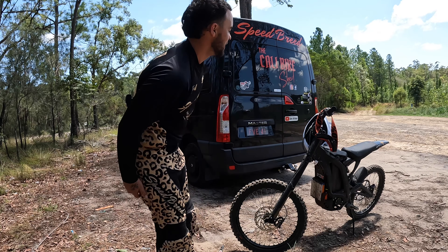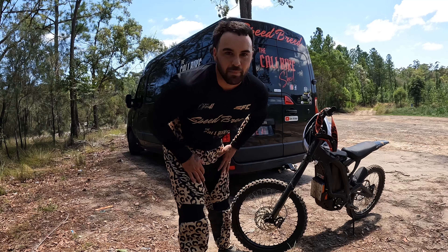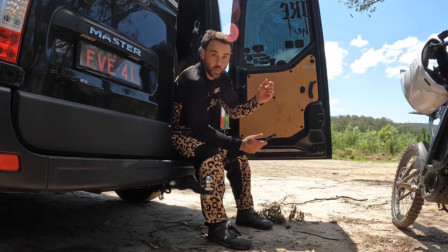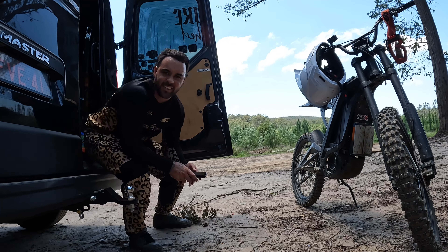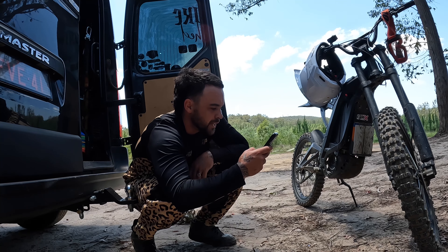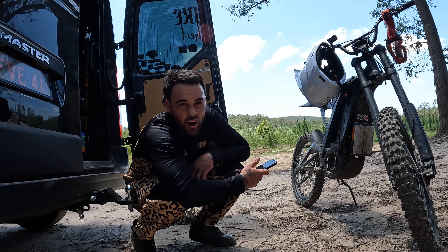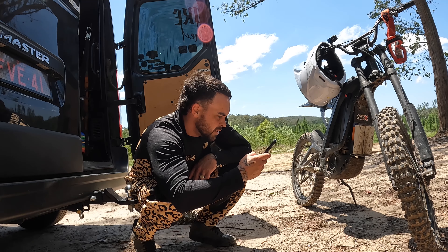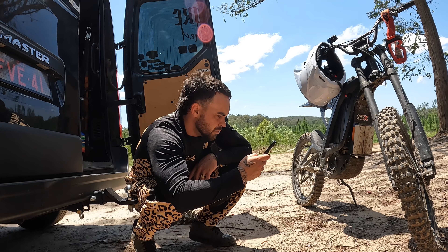So Error 21H and Error 30 came up — they're gone now. I'm gonna check the manual and see what's up with it. It is a hot day today, I'm sweating bullets. I feel like it could be a heat thing. Error 21H is an overcurrent error — most commonly shown when getting cutouts from jumping the bike and revving the motor in the air. I don't do that... all the time. Error 30 — unplug every connector, unplug the kickstand. Don't have it. Recent crashes? No. Wash your bike? No. Ridden through water? Yeah, I guess some water got picked up — it's all about the connection.